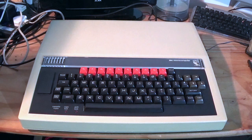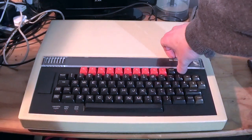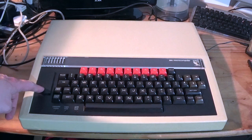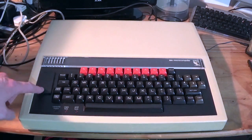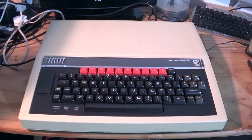Let me show you under the hood of the most common type of BBC Micro, and this is where we hit a slight problem. So a quick crash course in BBC Micro identification: this is a BBC Micro Model B, one of the most common types you can find in the UK. The Model A, B, and B Plus all had this form factor, which mainly consisted of a mechanical keyboard without a numeric pad, a separate clip-on plastic top banner piece, and also what we call the 'ashtray' — which some have punched out, others like this one have an adapter plate on.